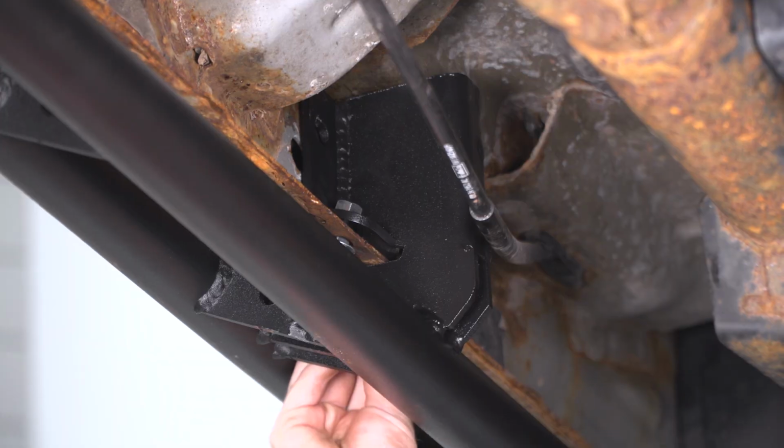All right, once you got those carriage bolts and nuts in place on that first bracket, go ahead and do the same thing for the other 2 brackets and you'll be good on the bottom portion. Then you're gonna grab the hex head bolts and flat washers in the kit. You're gonna shove these into those speed clips that we installed earlier. Again, you're only doing the rear and the front brackets. We're avoiding that center bracket in the case of our 2010 truck.